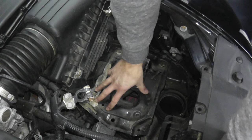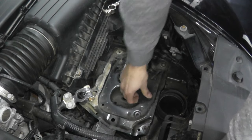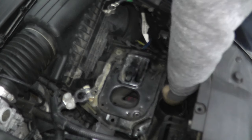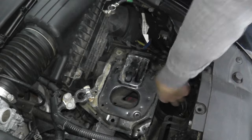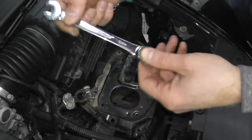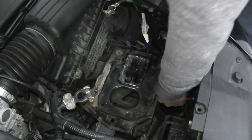If you do have to remove a battery plate like this, I have all the top fasteners removed but something is still holding it on — typically they hide one on you. In my case, on the left underneath the tray there's a fastener in very tight room, really hard to fit a socket and ratchet. Grab one of these ratcheting wrenches — makes all the difference. You can typically pick up a set for about twenty-five to thirty bucks and it's worth every penny.